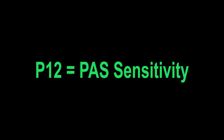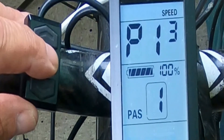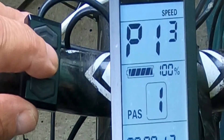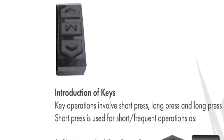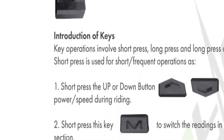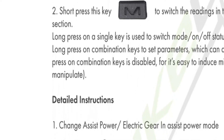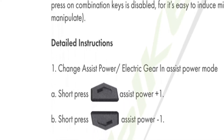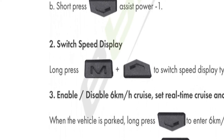P12 is where you can set your range for power assist — either three or five, which gives you a little more sensitivity between settings. P13 is the power magnet steel number, referring to the number of magnets on your pedal assist magnet, usually 8 or 12, and you can count them yourself. Depending on your manufacturer and LCD version, there can be more than 13, 14, or 15 settings — that varies from manufacturer to manufacturer. For additional settings beyond what I've covered, you can find manuals online pretty easily.